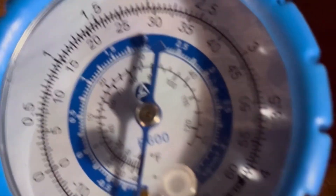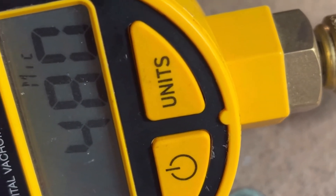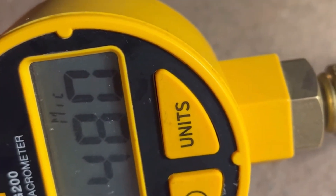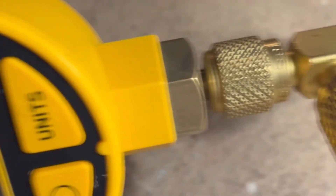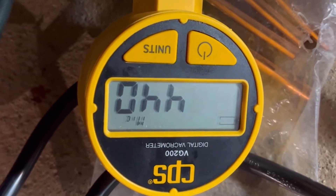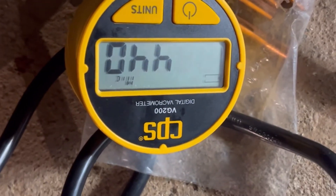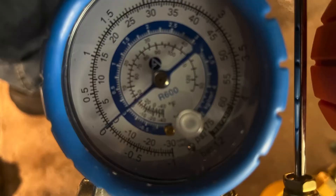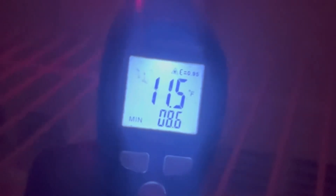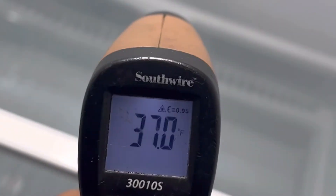That's pretty much the perfect vacuum right there. We're at 440 — that's plenty. That will suck in whatever refrigerant I need to pull in. We're going to be putting in about two-point-something ounces — I'll confirm right now. She's ready: at 11:12 she's at minus 40, so she's definitely cooling down. The refrigerator should be getting there as well — it should be at 38 or 37.